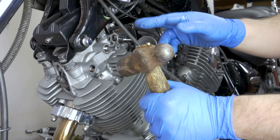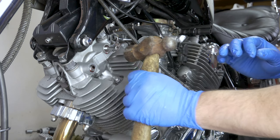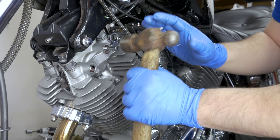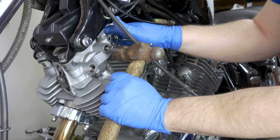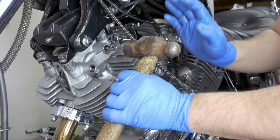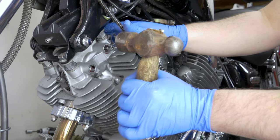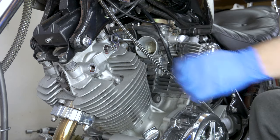When you reach the other end of the cylinder head casting, it goes a little bit stiffer, so it doesn't slide as easy. But just keep going until when you hit it with the hammer, the sound it makes — it's not that dull as when you hit it and it slides. It becomes like the whole engine starts taking over that vibration, that sound, and you will hear it — it's bottomed out. And that's where you want to be. So it started making that noise — the whole sound of hitting this bolt changed into the whole engine taking over the vibration, it will change the sound. Make sure you check the rocker — it's got to be absolutely free movement there. That's definitely on the bottom. Then you just take this bolt out.